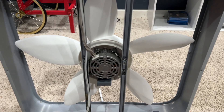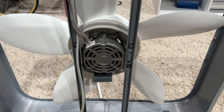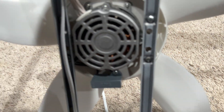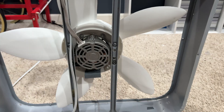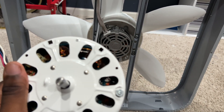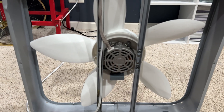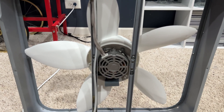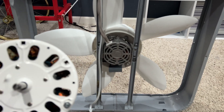This is the Airflex box fan that the motor initially came in. I swapped it back in, and what I'm going to do is run this motor with this blade set to see how fast it spins. Then I'm going to swap in the McMillan motor and see if there's any performance difference — which there definitely will be. If the 1.1 amp motor was faster than this, it's going to be quite unfair for the newer WeatherShield motor.